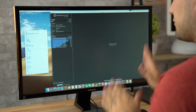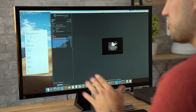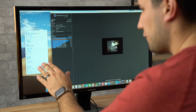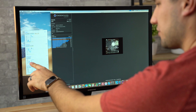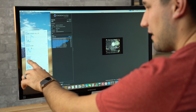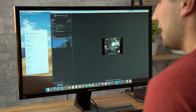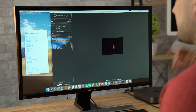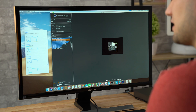I'm going to hit CPU run and right away — 92 degrees, 100 degrees. That took about three seconds to get to 100 degrees. We spiked at roughly 4.3 gigahertz and instantly hit 100 degrees Celsius. We're still at 100 degrees — that is insane. I'm hearing the fans starting to spin up. They need to hurry up because our frequency is going down to 3.38 gigahertz. That is above the 3.2 gigahertz base clock speed. The MacBook Pros with 6 cores even slowed down below the base clock, which should not happen. Our result is 1,144 — I'm going to hit run again to continue testing.